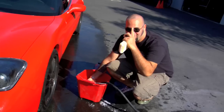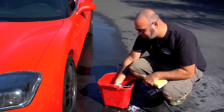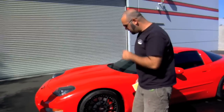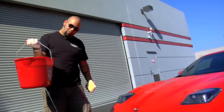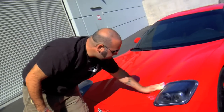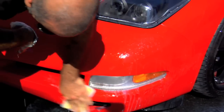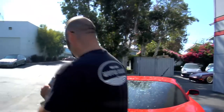Regular old car washing soap — I like Black Magic stuff: A, because they sponsor the show, and B, because their products are actually good. I wouldn't plug them if I didn't think their products worked. We're not using any professional detailing products, so this is all stuff you can do at home. Now that our bug and tar gel has set in, we're going to rinse it off with the soap and the sponge. If you don't get bugs off quickly — like those love bugs in Florida — the chitin in the bugs' shells can really eat through your paint, so you want to get the bugs off as quickly as possible.